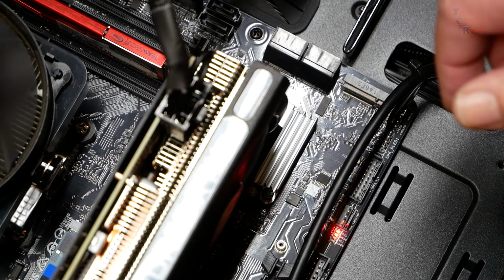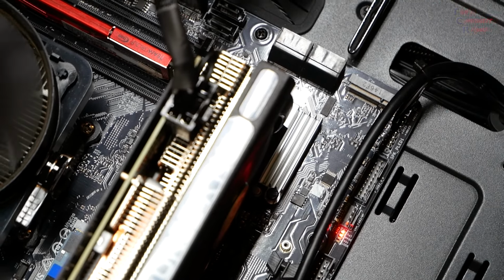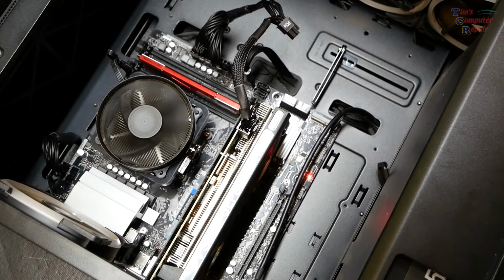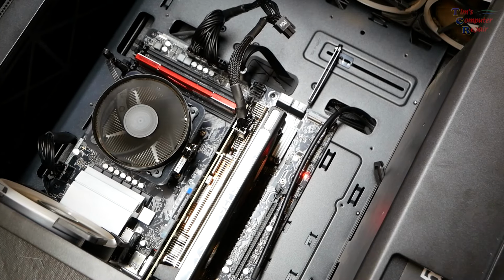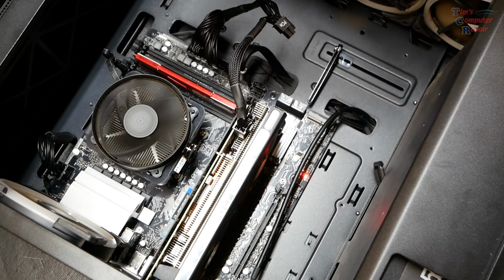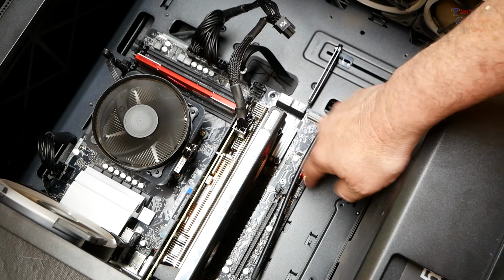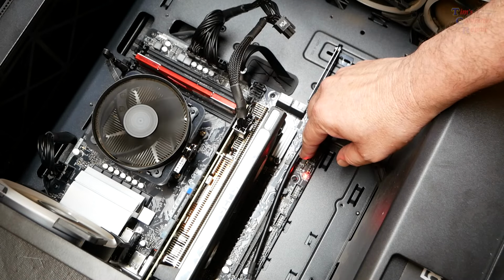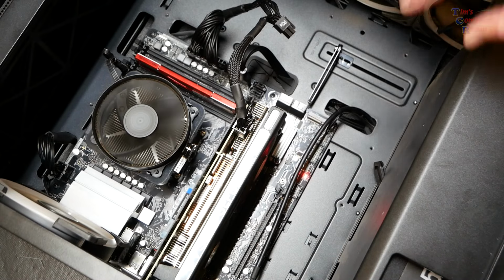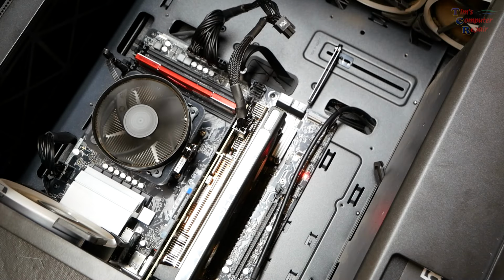So we're going to try to troubleshoot this and figure out exactly where the fault is. At first glance you would think motherboard, but as everybody knows in this line of work, don't ever assume anything. So what should my next steps be? Tell you what, I'm just going to remove this RAM stick altogether just to see. I'm trying to get these lights to change to something different, to get some kind of notification to me that the motherboard's trying to do something. But the few little things I've done, it hasn't done anything.